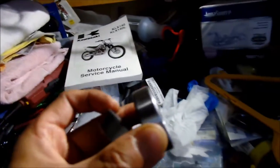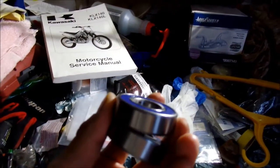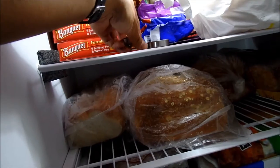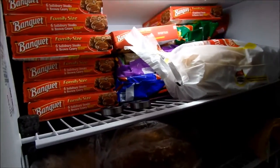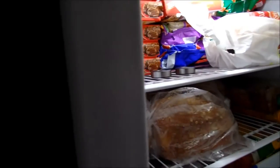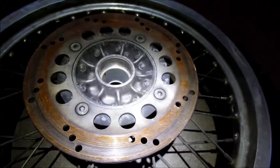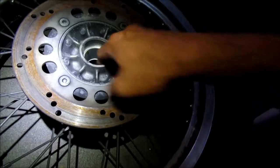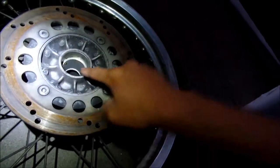They're all greased up and ready to go. Even before you try taking the other bearings off, I suggest repacking the bearings since they don't come with too much grease. So what I'm going to do now — if you have a freezer handy, leave the bearings in the freezer for about 15 to 20 minutes, maybe half an hour. Then we'll come back and put them on. I'm also going to add a little grease to where the bearing pushes in, just so it has some lube.